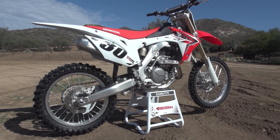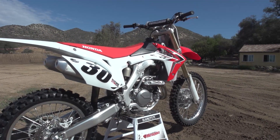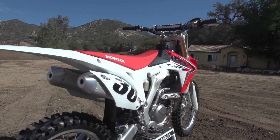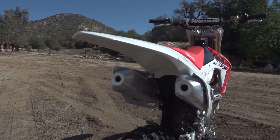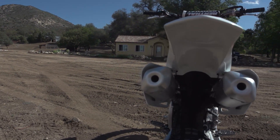Some of the major changes on the 2014 CRF450R over the 2013 model is the engine gets some revisions. It gets a brand new cylinder head with a new intake and exhaust shape — a little different port shape than last year's model. It also gets a new exhaust system which has a different separator in the Y pipe, just to improve the flow efficiency of the exhaust system.